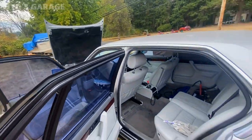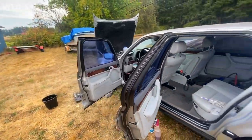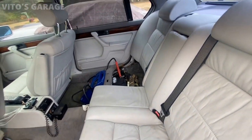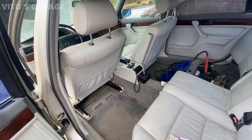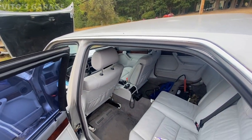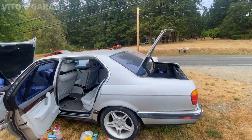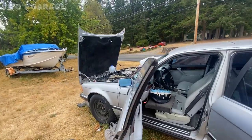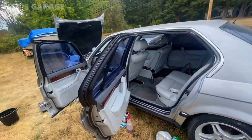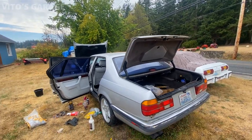What's really amazing — and this doesn't just apply to classic BMW but also classic Mercedes — is that all the doors have the VIN number stamped on them. I started removing the carpets and will be cleaning the seats, leather, and everything, then preserving it all. This car also has a bit of a moldy smell, so one of the seals might be leaking. I want to clean the interior, make it nice, and preserve it. I'll use automatic transmission fluid on the door locks and moving parts, as you guys know me.